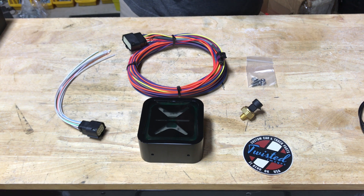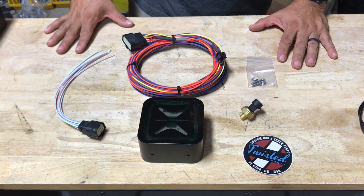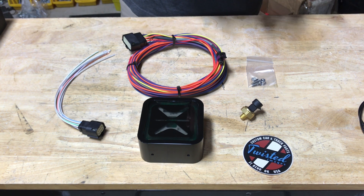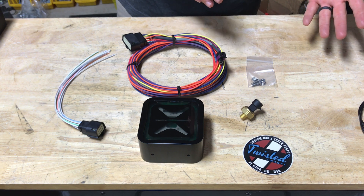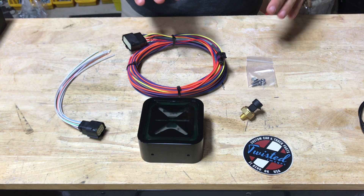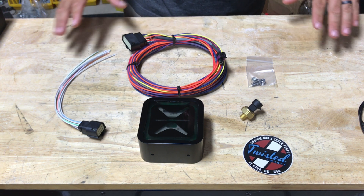Nice, high-quality, really nice-looking products. The new eConnect system had sort of just been released when AccuAir decided to close down, so there's still some confusion over how the packages work. The earlier AccuAir systems, you had two options essentially — the switch speed and the eLevel. The switch speed was the basic, just a controller, where the eLevel had the height sensors and gave you digital height control over your air suspension. With the eConnect, it's a little bit different, so I figured I'd take a moment and show you the different products, the different components, and how they interact with each other and what your options are.